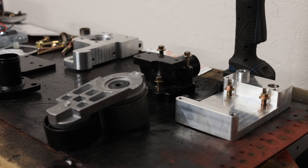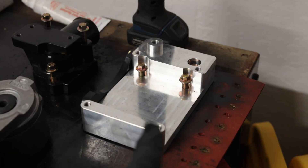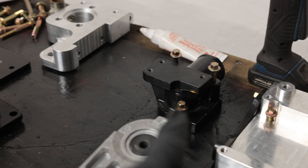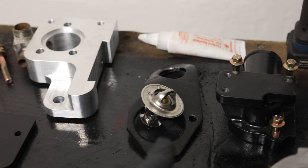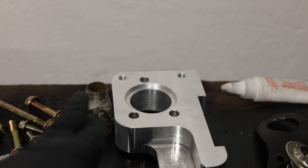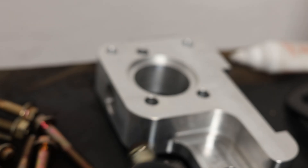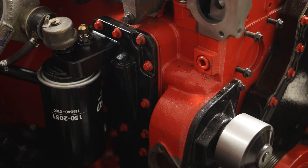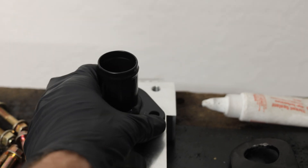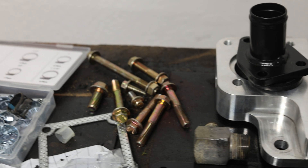What we have here is the heavy duty high mount bracket from Jonesy's, or Adventure Vehicles Northwest. The kit includes the AC bracket, a tensioner pulley, a water inlet that sandwiches against the lifting bracket and thermostat, and a water outlet for the lower portion. The water inlet pipe for the heater core installs into a machined port on the side — you'll want thread sealant on it before installation since that area gets congested near the oil cooler bolts. The water outlet is one and a half inch so it works with the Toyota radiator hose, and the kit comes with zinc-plated hardware.